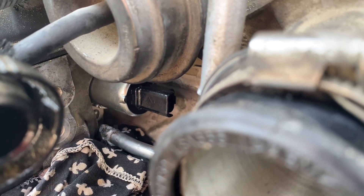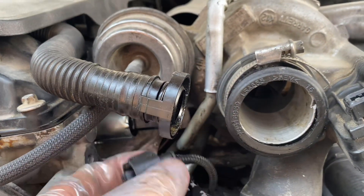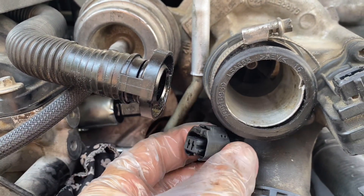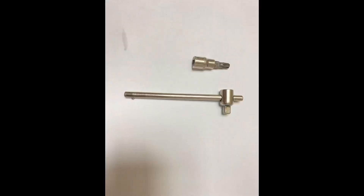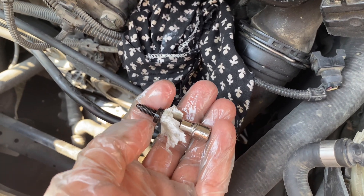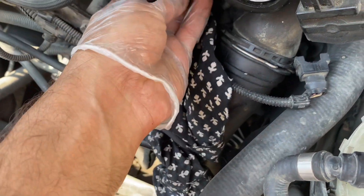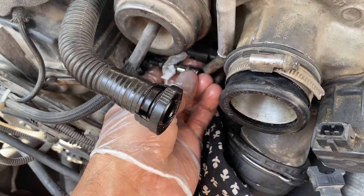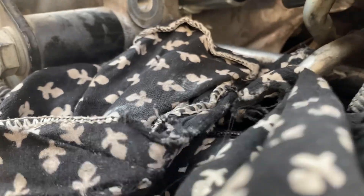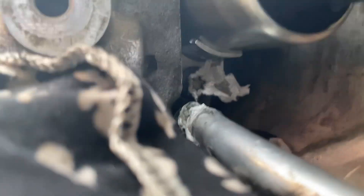It's really easy — it's not a big deal. If I can do it, you can easily do it too — I'm not a pro. You connect it behind the oil pipe. The tool you need is a Torx 30 bit. I used a tissue so that it holds the bolt properly and it won't fall down. First finger-tighten it, then use the tool to tighten it fully.